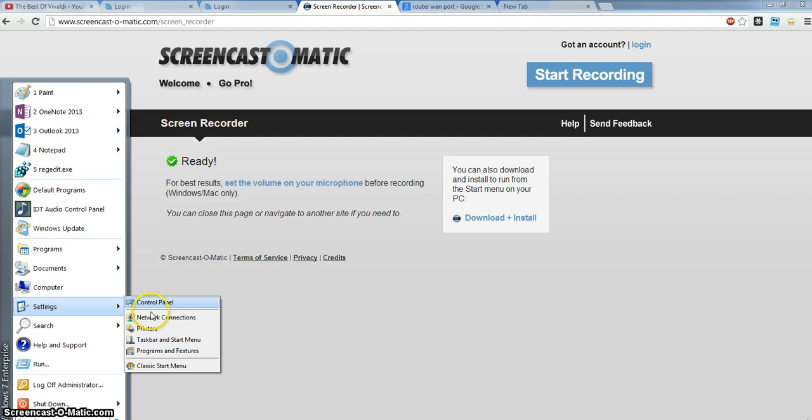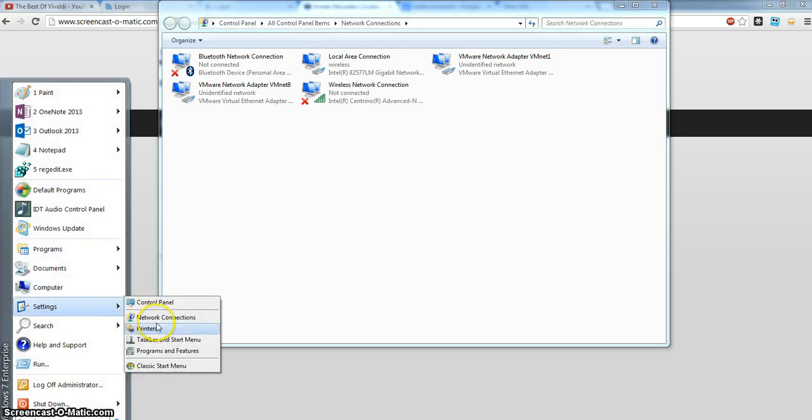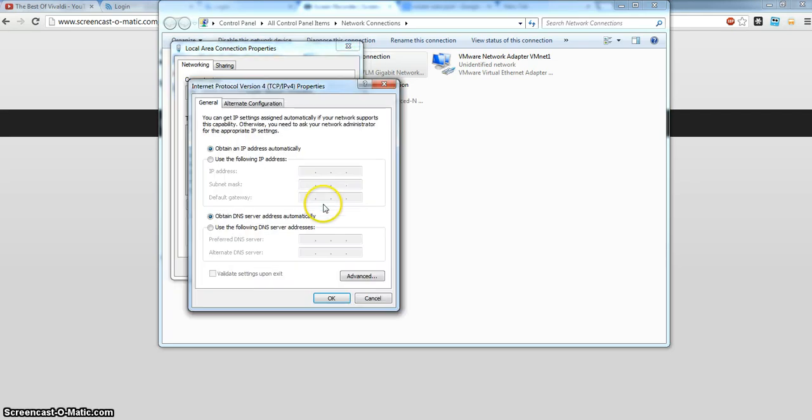First of all, this is something that you can probably find in videos on YouTube, but if you want to connect your nanostations, you have to set a static IP on your computer. Do that by going to, well, you just saw what I did, right? Settings, network connections, right click on LAN, local area network, and right click on Internet Protocol version 4. What you have to make it is 192.168.1, and the last number can be anything. It could be 20, it could be 25, doesn't matter. And this is going to be 255.255.255.0. Once you've done this, click OK. All right, you'll click OK, it'll register.